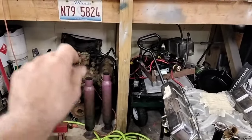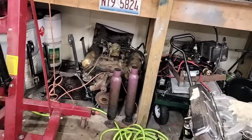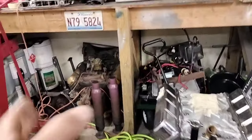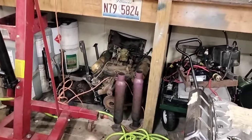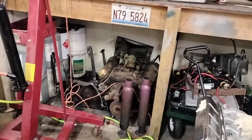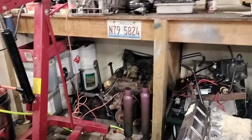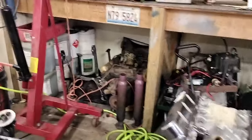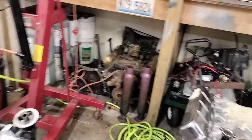This is an untouched, unopened 1970 350 Oldsmobile — the higher-compression motor, supposed to be around 9:1, but if we get eight and a half to one with a towing cam that'd be good. I need something to practice on, and my machinist wants me to do a build start to finish on my own. Right now I'm in the training phase — he does about 75% of the work and I do the rest, mostly learning setup. So far so good; he let me bore two holes and I didn't ruin the 427. Share, like, subscribe, and follow me on Instagram at Copper Cutlass.